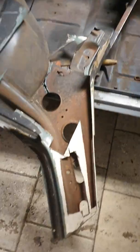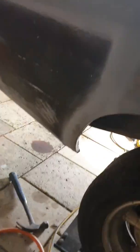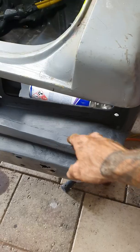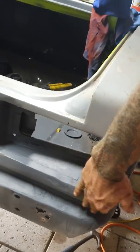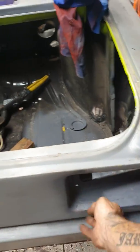She's pretty stripped now. You've probably seen them anyway, but we've replaced the rear quarters on both sides. Did a bit of welding in the boot — to replace all inside here, weld up a few holes. Still got to cut this one out and replace this section like what we did over here. Obviously it's gonna need a little bit of fill, just a skim coat over the whole car — that'll all be neatened up.